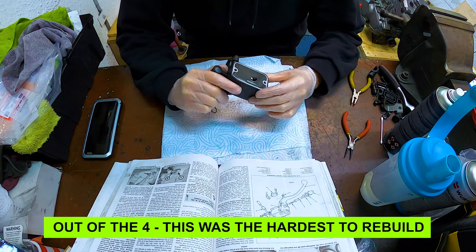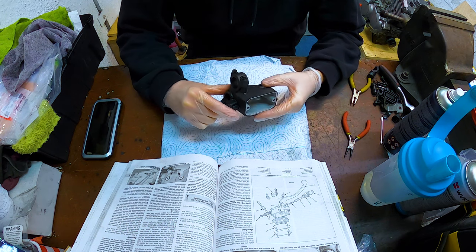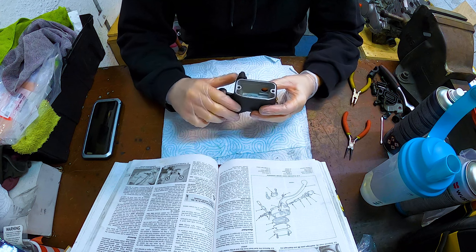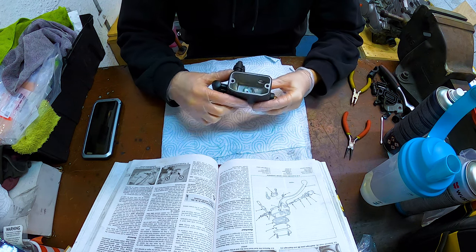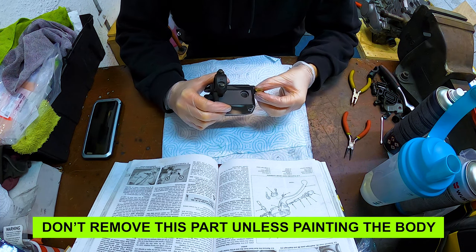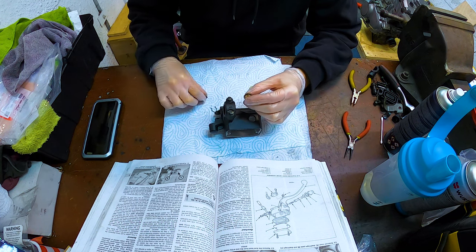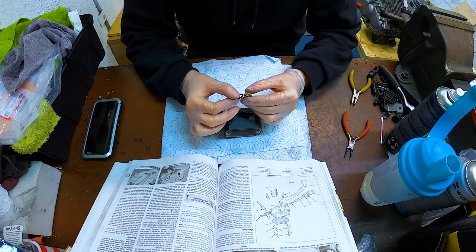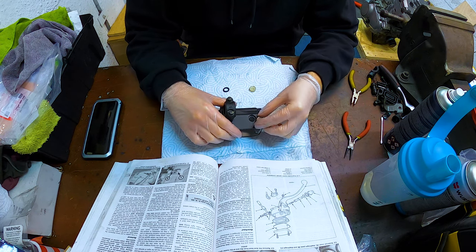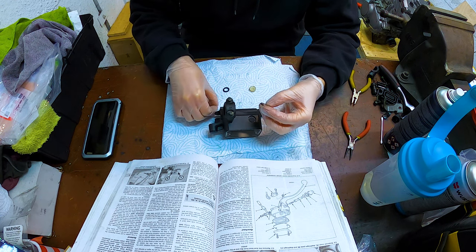Right then, that's another job done. I'm going to look at putting this master cylinder back together now. I bought a Brembo kit for it — you have to use the official one for this, it's quite expensive, so I don't want to mess this one up. Hopefully I'll get it right first time. I've given it a real good clean out because it's been blasted before it was coated. First bit will be to stick this little window sight glass in the front — I can't seem to get an O-ring that's the same size in the thickness because it's quite a tight fit.